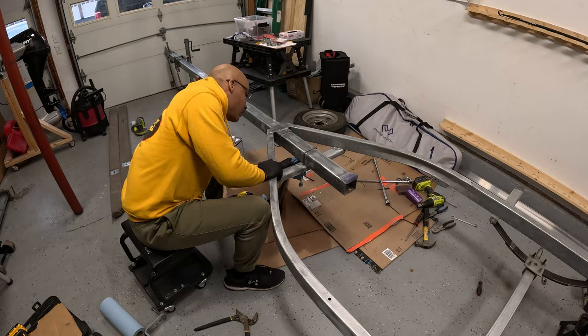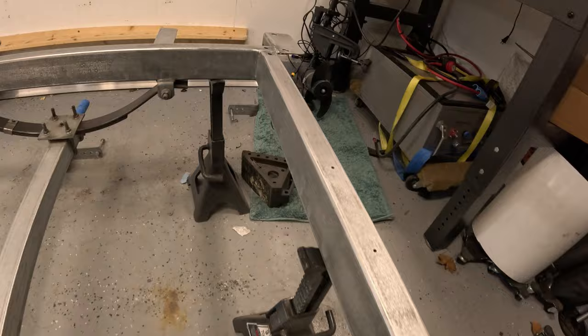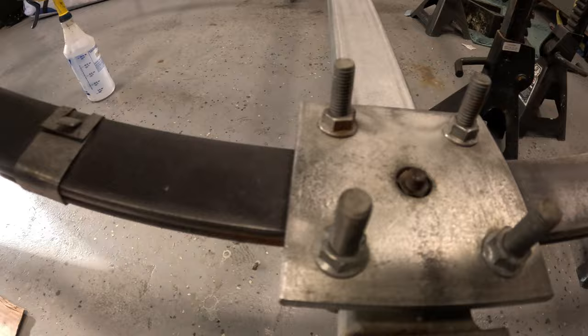After sanding, I cleaned with acetone to remove any dust or residue left behind before painting. Be sure to tape up all your lights as well as any labels like your trailer specs, regulatory stickers, and of course your VIN number. I'm going to do one more round of cleaning where I'll use 220-grit on the orbital sander, sand, then wipe down with acetone, and then I'll be ready to paint. I think I did a really good job getting everything cleaned up. With any paint job, 90% of the work is prep — so I was able to get a lot of the rust and calcification off.